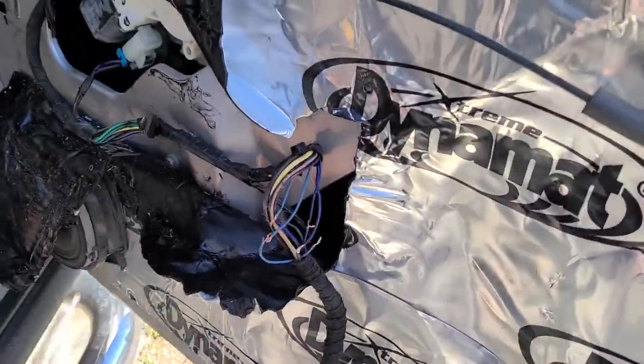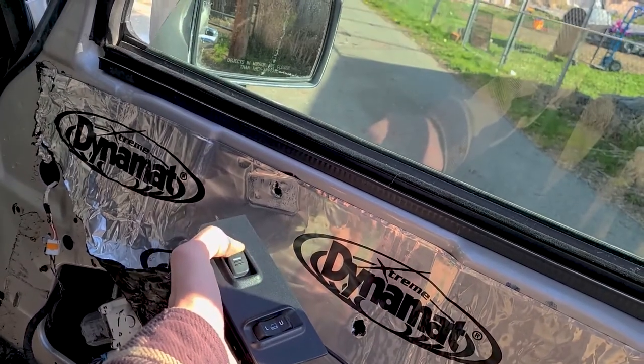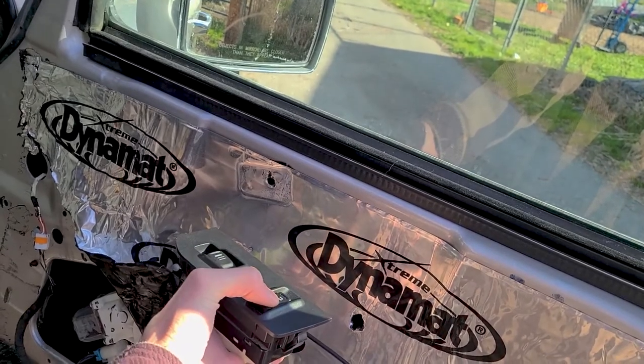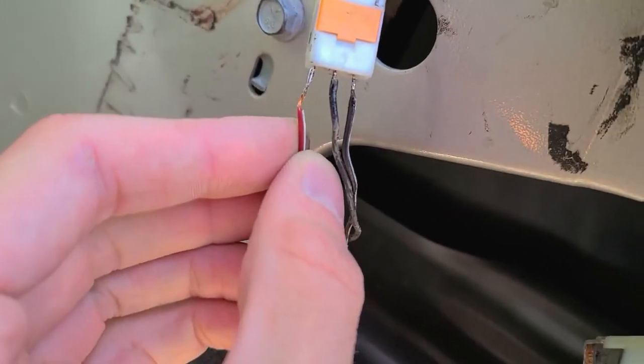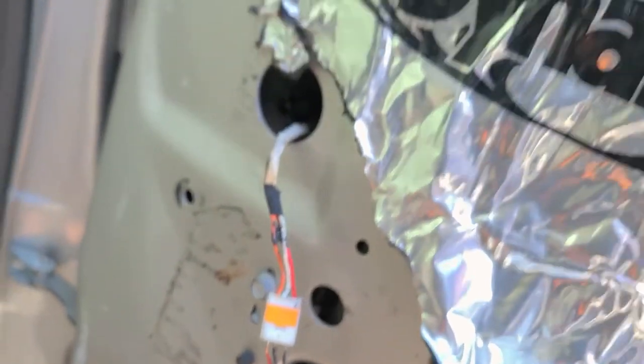Alright, so Lucy and I are out here. I'm going to do one last test — make sure the power windows roll up and down, the power locks unlock and lock from this passenger door switch. I wired stuff backwards the first time, so when I rolled down the window it would also lock the door, and when I'd try rolling it up it wouldn't roll up. Just a reason to mark my wires next time. Alright, the functionality works properly. The power mirror still doesn't work, so that's next up on the list.